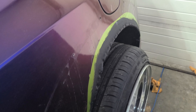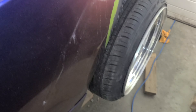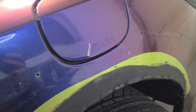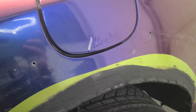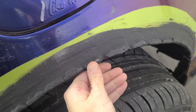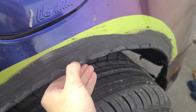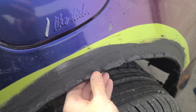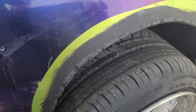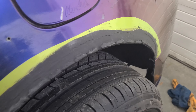This is what my car looks like right now. Not so pretty. It's all sealed, it's all dry. Looks like my kit may have hit a little bit right there, which isn't a big deal — I just pushed the silicone back on there. We use this type of silicone because it actually stays a little bit moldable, so that if your body moves at all, it doesn't crack.